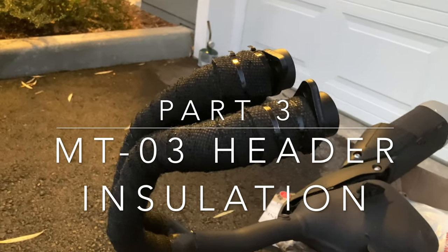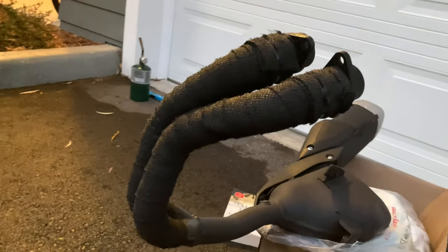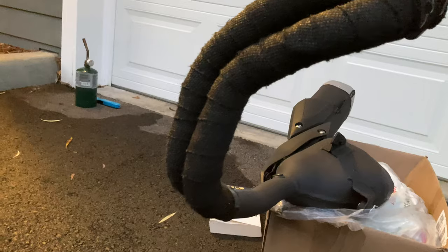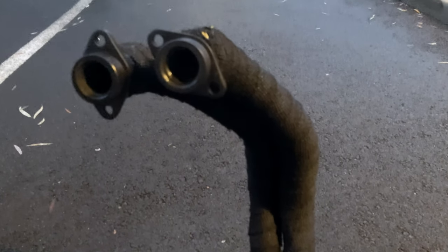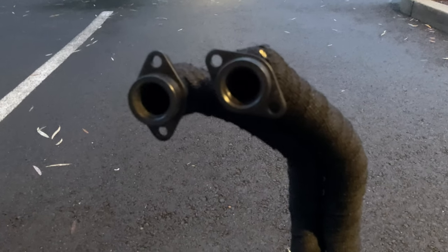Another very generous coating of high-temp silicone paint to the exhaust header wrap, and then a thorough heating with a blowtorch to help cure it into place. Here we can see the wrap smoking — it actually caught fire once and then burned out. You can see the smoke pouring out of the tubes; I got it really hot to cure that paint.